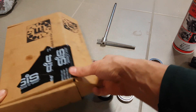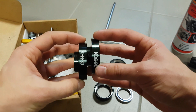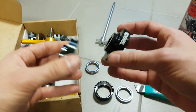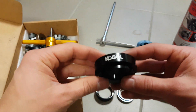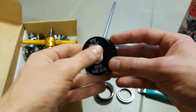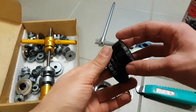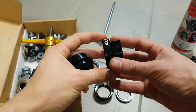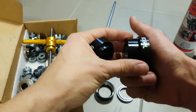The drifts I have used for this setup are from Kogel, and these are all for the 30mm bottom brackets — they fit all of them. There are actually three of them. These are in case you have both sides installed, and this one is for the first cup you are going to install. It fits snugly against the frame, so you have it aligned very nicely. First you use this one on one side, and then you use both bearing drifts together. This way you get a very easy, very secure fit. The bearings are perfectly aligned, as I can show you here — they fit into the cups very nicely.